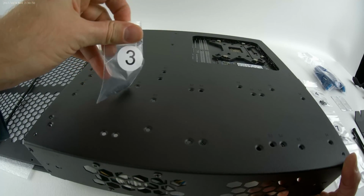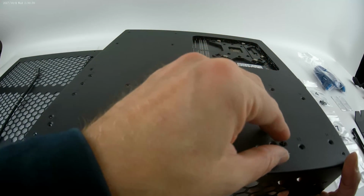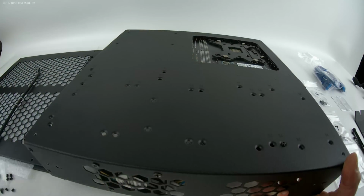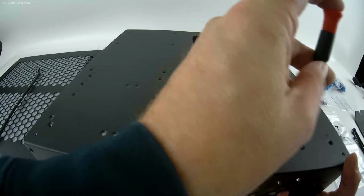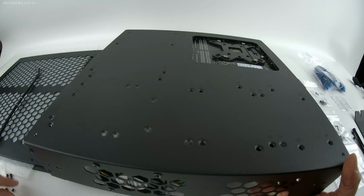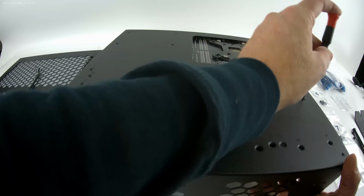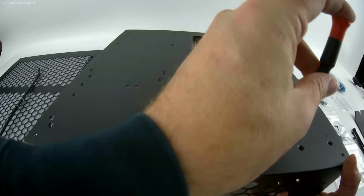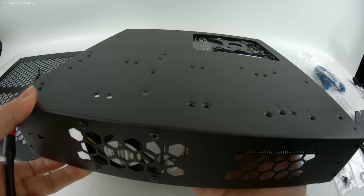I found that twisting the top of these can get it open quite easily. There's 16 of these M3 screws designed to work with these 2.5-inch drives included, because you can have up to 4 of these 2.5-inch drives installed inside one chassis. I install the corners first, that way you know it's at least mostly square, and you don't have to keep holding it from the other side. Don't tighten it too tight. You don't want to strip the screw holes in your drives.